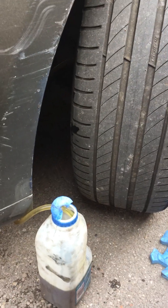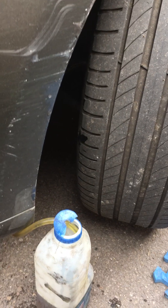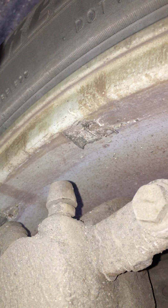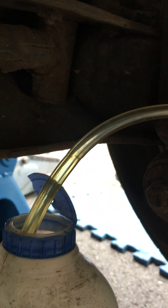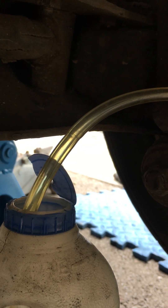I've moved to the nearside and as you can see I haven't even had to jack this side up to get to it — I just had to turn the wheel. I've located the rear brake nipple, slightly less accessible but still can be bled with the wheel in location. As we can see here, perfectly clear fluid coming through, no air bubbles, so it's all looking good.